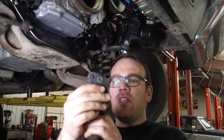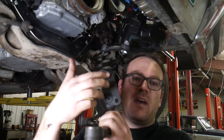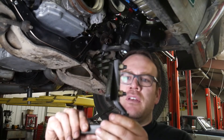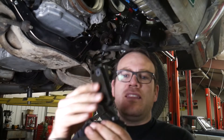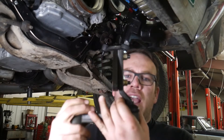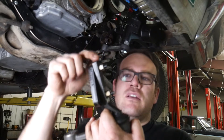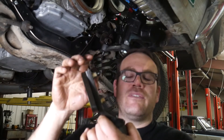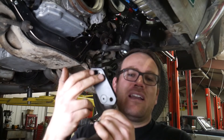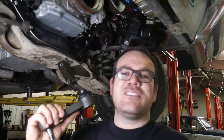On the idler arm, there's a little bracket that comes in the kit. It has tapered holes in the back with allen screws going through, and it came with a couple of fine-thread nuts and lock washers — looks like grade 8 hardware. We need this bracket because the original idler arm had offset holes, and this is an upgraded, beefier idler arm. I put a little bit of medium-strength Loctite on the bolts even though they have lock nuts, because you can't get to the allen on the back once it's installed. Now I can mount this up onto the frame.